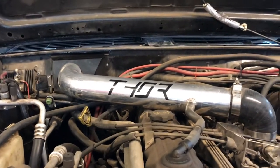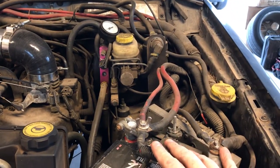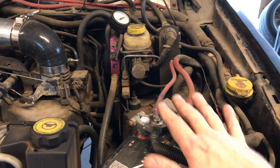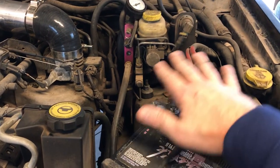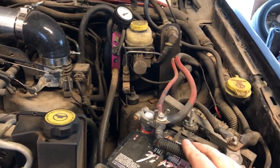As you can see, normally we would have an air filter or air filter box here. If you had a snorkel there would still be an air filter box here. So one of the first benefits is that it clears up all of this space over here in the engine compartment — in this case for a battery.